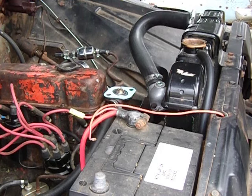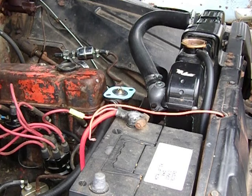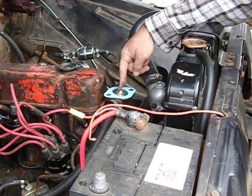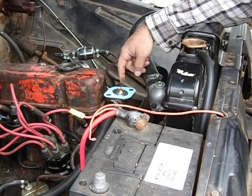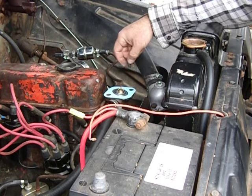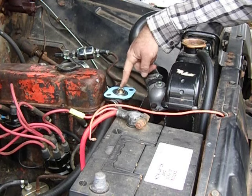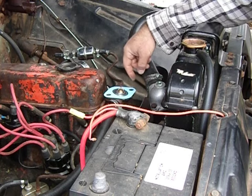If you're flushing your coolant — which with green coolant should be every two years or so, sometimes three, but according to the manuals it's two — if you have the thermostat off anyway, why not replace it? It's about ten bucks or so with the gasket, and they're not expensive. If one of these goes bad it can wreck your engine, so it's a small amount to pay for safety.